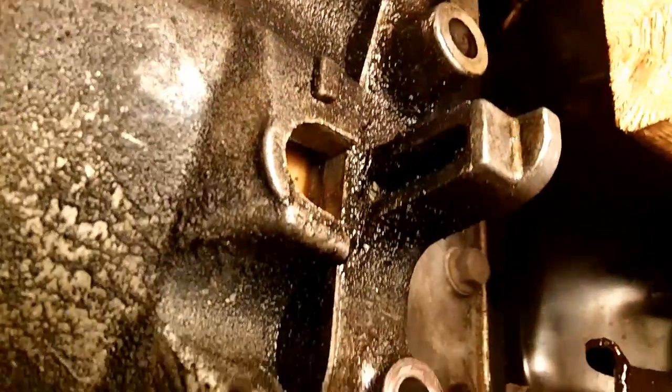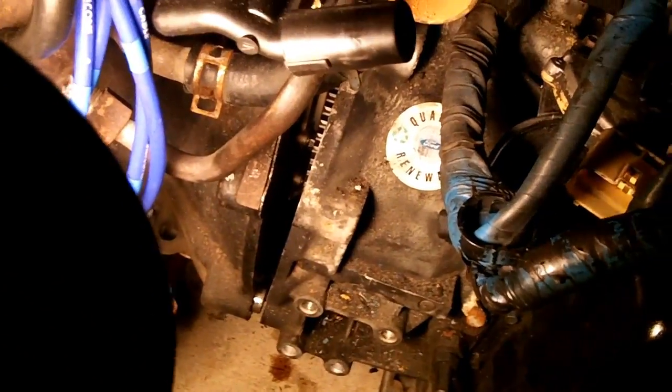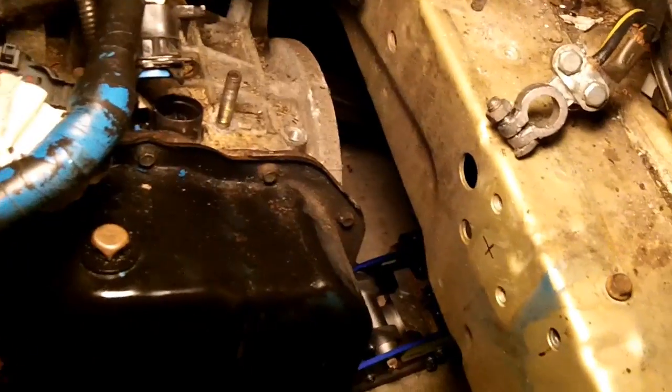And while I was down here looking for the reason maybe why it's not splitting, of course I come to that. Look at that. It makes so much sense because it's splitting on the top, but it's not splitting on the bottom. So I got one more bolt, and that looks like a, what are you gonna guess? 14 millimeter. And after that 14 millimeter bolt was out, of course, it just split like an egg, right onto the jack stand, which is down over there.